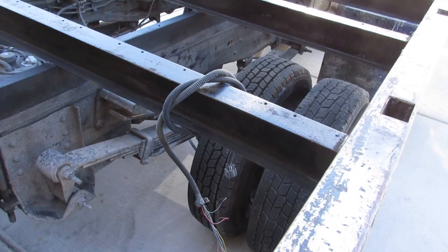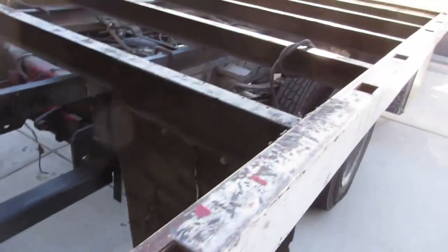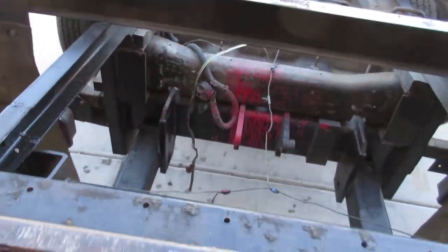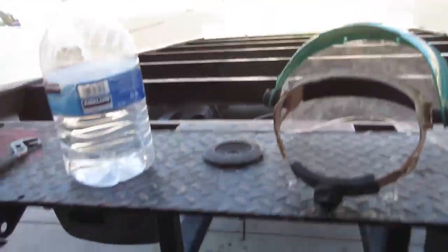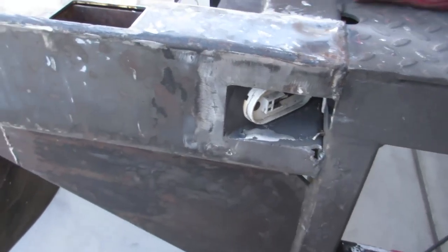And like I said, I busted up my freaking thing. I heard something, I was like, I wonder what that is. And I'm like, oh crap. You know what I mean? Good thing it wasn't plugged in, so it shouldn't have shorted anything out. But I do have that taillight converter, so it's already wired to the flat four, and I'm not going to use the flat four for a trailer or anything. I'll just wire it in, like I said, to the K10 lights and to my lights back here. So it'll be good. I don't need the amber, I just need it to stop and turn.